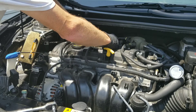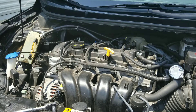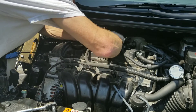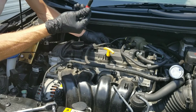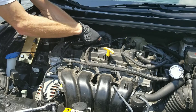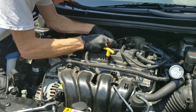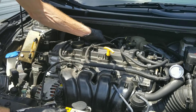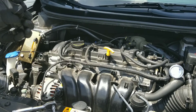Pull these coils out. Just kind of loosen them up a little bit, it's what I always like to do. These clips are a little bit aggravating. I use a small precision screwdriver. You can use something similar if you have coil packs like these with clips like these, because you want to unhook the clips. You push this little tab back on the clip and you'll see this small silver tab pushed out to the side. Pull up and you've got it out. This way you're able to move it around.